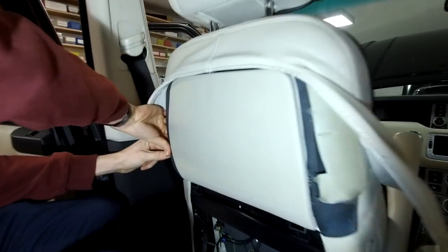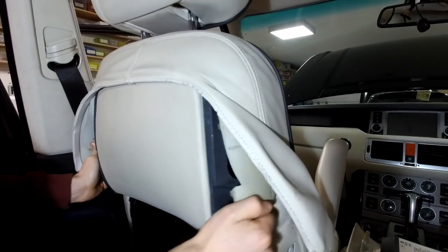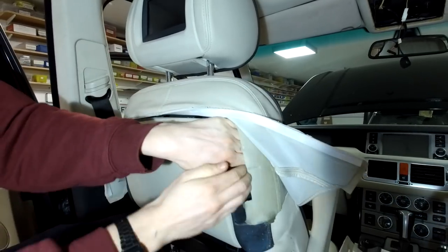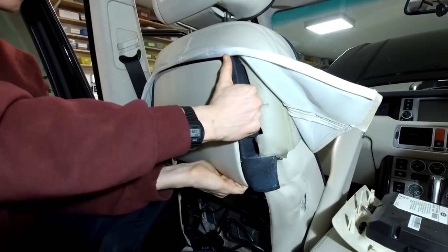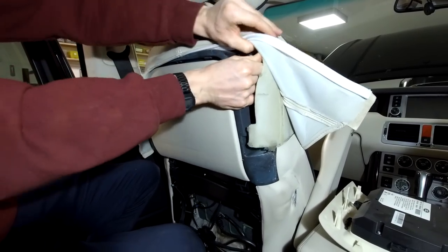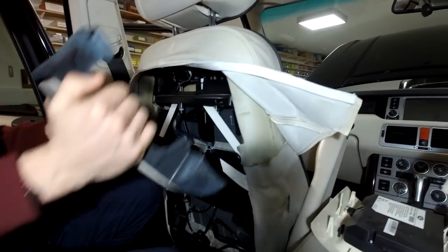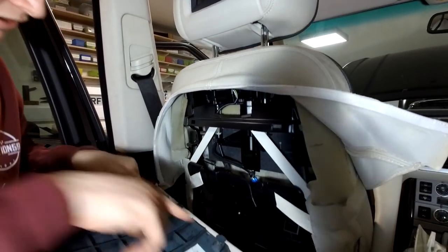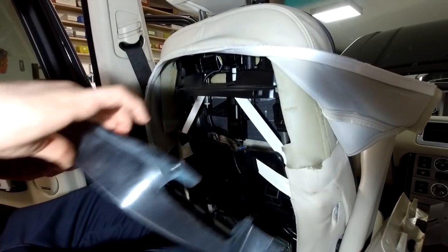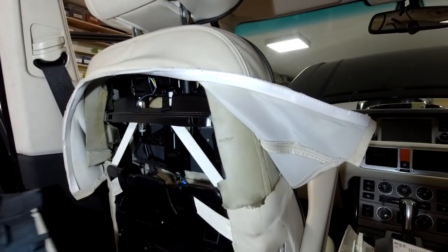Considering a career in upholstering here - no, not loving the upholstery. Those guys that do that are awesome. It's just the one clip inside - it should just untuck. It's got quite a big bit once you get one side out. The big sort of ears at the top are tucked under the foam, and at the bottom you've got to wiggle it up because there are two tabs that sit in these slots - slide it up. Putting it back together is a different story, but that will then cut the ears off the back of the seat so you can trace any cables if you've got problems.